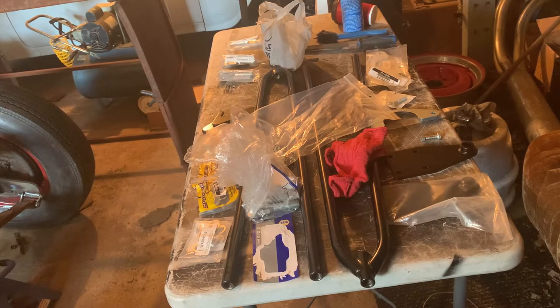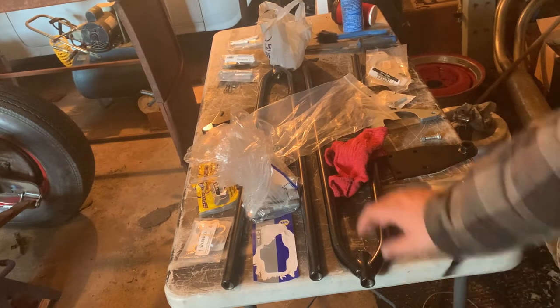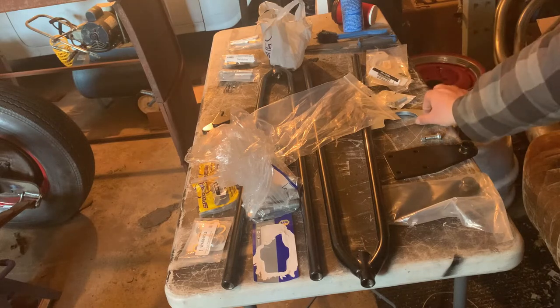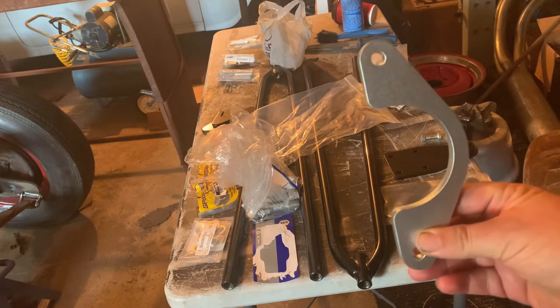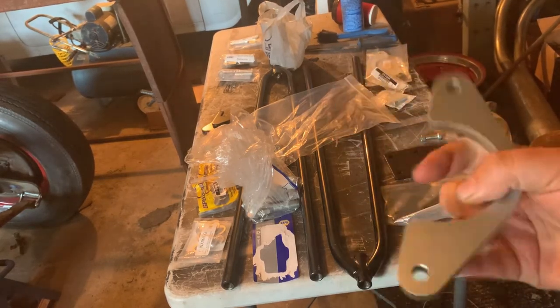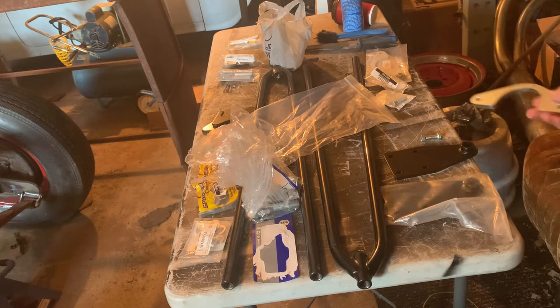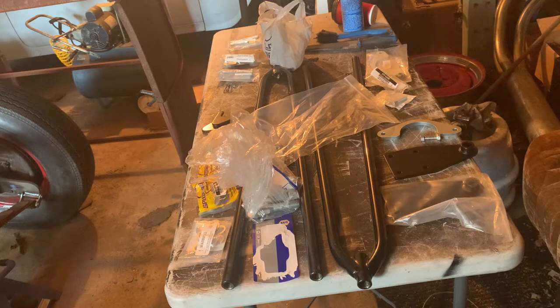Got some hardware, so now I can assemble these hairpins. These will be for the rear. The next thing I'll be working on is putting these mounts — these weld to the rear diff. But man, what a hassle getting some fine thread grade 5. The bigger stuff I step up to grade 8. Apparently no one stocks grade 5 fine thread — people just buy grade 8 instead. If you're buying grade 5 it's just the coarse, and not anything bigger than a half inch. I needed a five-eighth.